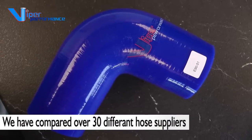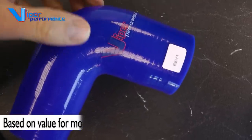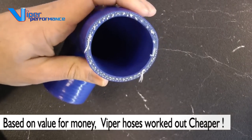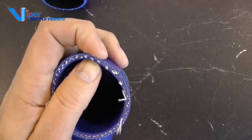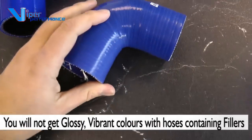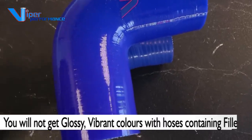Sometimes people say to me, I can get hoses which are half price. This is a Viper standard hose — a 51mm 90-degree elbow with 100mm standard 4-inch legs. A cheaper hose is 80mm in leg length. This is a hose that arrived to us like this from a popular brand. Cheap quality fabric that just again pulls out and frays. The hose is just under 80mm in length and the thickness is reduced. Quite often hoses have a lot of filler in there — a material which is diluting the raw silicone, making it cheaper. So: 20% less on length, thinner hoses, lesser materials. Of course it should be half the price.